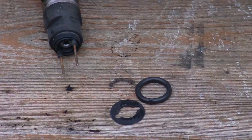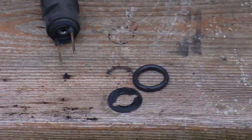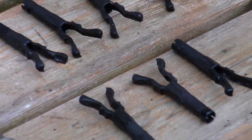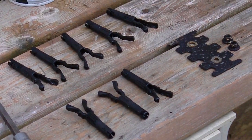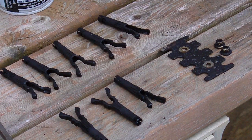You can see the parts that go on the end of it. I took the clips off of my old spider. And when I took the plate off this spider, the screws weren't even tight on it — and that's a good reason why it blew out. The old one I took out of my engine had screws that were nice and tight at around 80 inch pounds. Those nuts I gave about a half a turn before I felt any resistance, and that's probably why it failed.